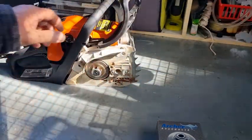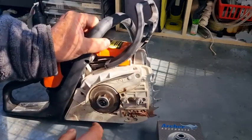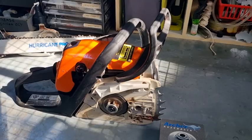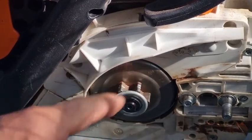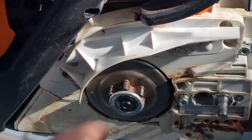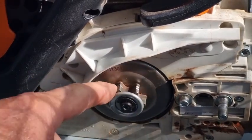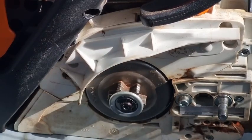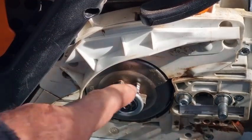I cleaned this saw up a while ago. One thing about these — if we zoom in, you can see it's quite easy to get damage on the sprocket, get a little bit of wear on it. To buy the whole drum is expensive, but this one is still quite serviceable — it's got a few little marks on it, they're not that deep, but another couple of years and I'll probably have to replace it.